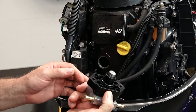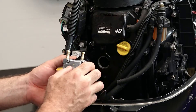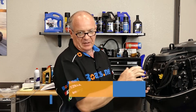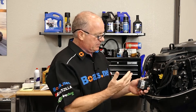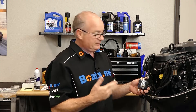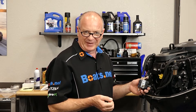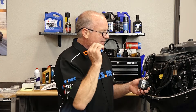On the bottom side, a new pump already comes with the O-ring that we need. We're just going to get it bolted back up, get the lines connected, and this one actually uses zip ties to hold things in place. Now if you're not going to use the OEM zip ties, make sure that you order some of high quality because they're going to be in a very hot environment under this cowling. The really cheap ones break down quicker and then they're going to release. Fuel swirling around the inside of an enclosure — I think that would end poorly. Don't cheap out. Make sure you buy things that will actually survive in this environment.